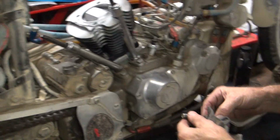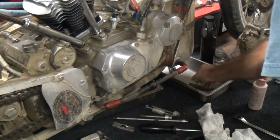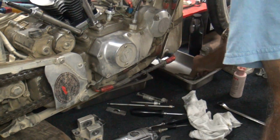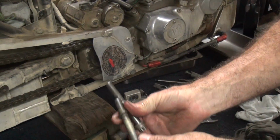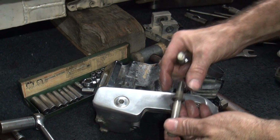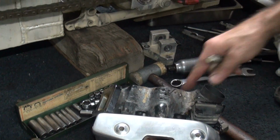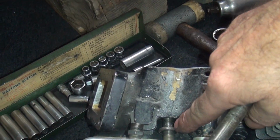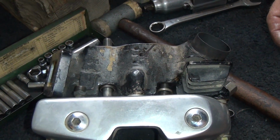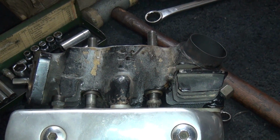We'll get our head bolts over here. Make sure they're halfway clean. These have to go in first. You make sure the washers are below the rocker box. Otherwise they get tangled up in the rocker box. See right here? It's a lot easier that way.